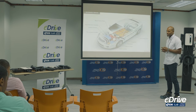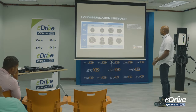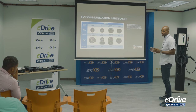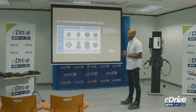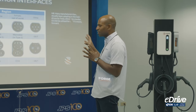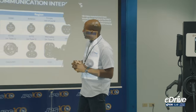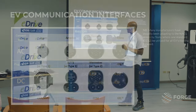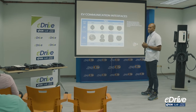Let's take a look at the different charging interfaces. It's going to be standardized — Tesla is pushing for CCS2 going forward, and they're trying to phase out all the different connections and get all manufacturers to fall in line with just one interface for charging. The J1772 is currently a US-based charger interface — most public charge stations in the United States use the J1772.